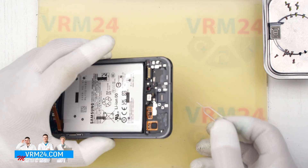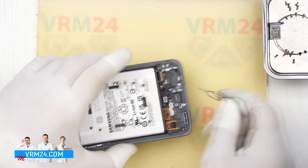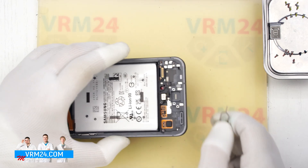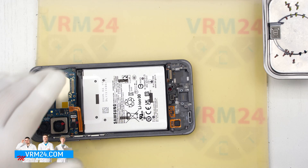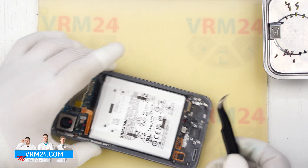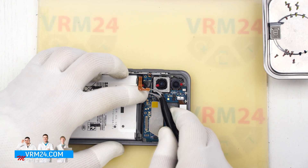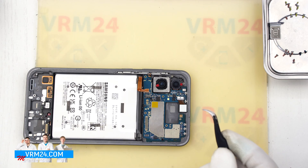Now let's do our usual quick test of the microphone. The microphone opening is located in the frame of the display. It has an L-shaped design and is protected on one side by a mesh or membrane. The microphone itself is on the subboard directly behind the hole, so if something is inserted into the microphone hole in the display frame, it won't damage the microphone itself — but liquids still could.